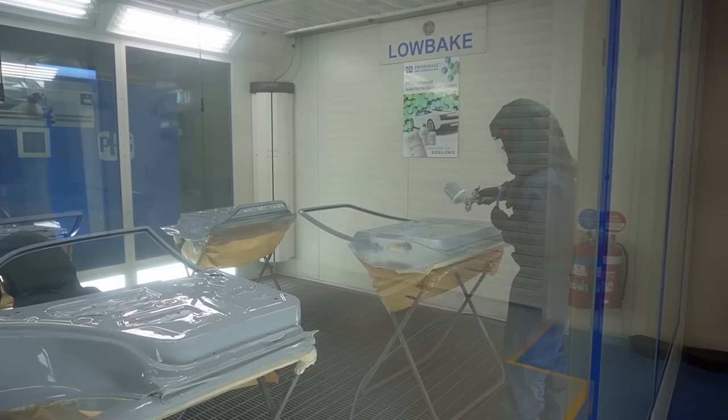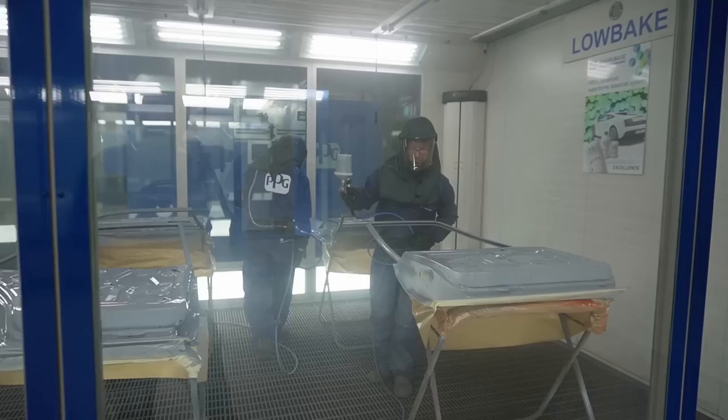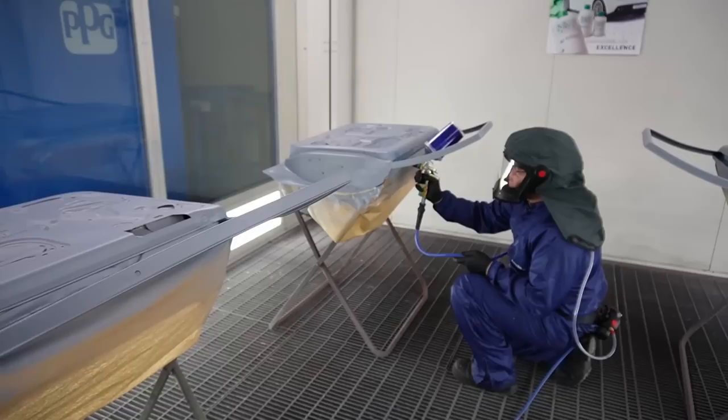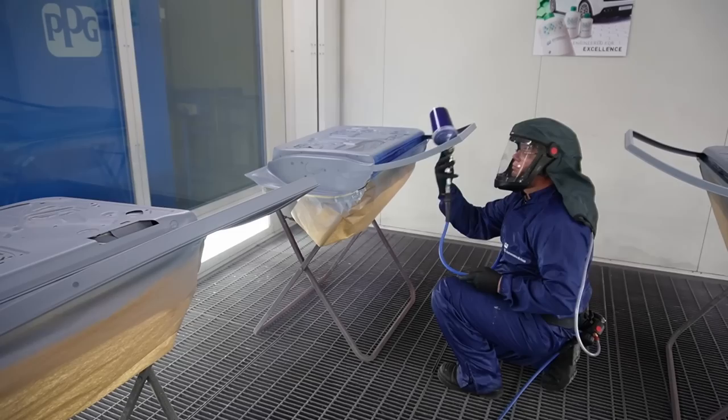So the wet on wet, it's a very thin layer. It's actually a self-leveling product. So it dries, if anyone's familiar with Electrocoat, it dries really smooth and flat. So it gives the actual paint surface a really good level surface. We get more gloss from the clear. It fills up any of the light fine scratches and just gives us a much better quality finish, and also helps with the overall colour and coverage. So we're going with some colour now.